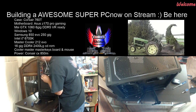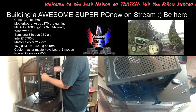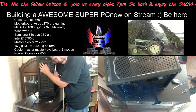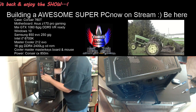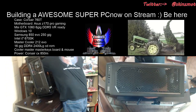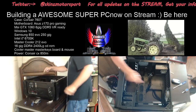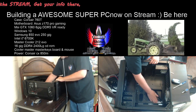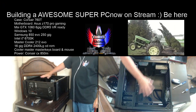Make sure that you get this nice and tight snapped in there, because you don't want it to offset your board when you're trying to put your board in there. What happens is your board will be cockeyed inside the box, so you want to make sure that this is snapped in nice and tight. Alright, we're going to lay the case down, bring these wires inside the large hole, except for the power supply, that can lay down. And then we're going to just lay these wires down inside that large hole, so that way we're not bending, breaking any of the clips or anything like that. We want to watch out for that.